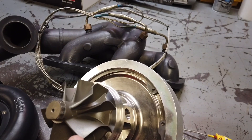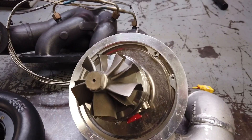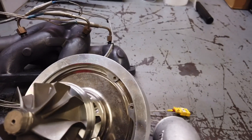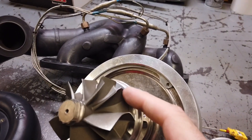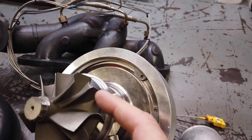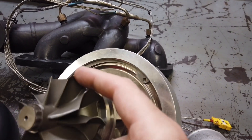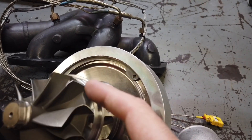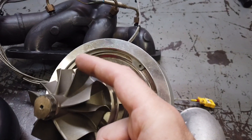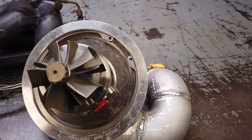On a T3 frame turbo you get a great reduction in turbo back pressure. You might think to yourself, okay, what happens to putting torque on the turbo shaft to make power? Well, as far as the gases exiting the engine are concerned, they haven't seen any reduction in the ability to apply torque to the shaft — because as gas exits the volute on the turbine housing, it's still pressing on each blade the same amount. Those gases don't know that only half of every other blade is there. So it can still accelerate the turbo and apply power just like it normally would, but when it needs to exit the engine, every other blade is effectively removed and the drive pressure, or exhaust back pressure, is significantly reduced.